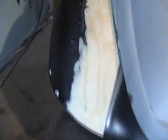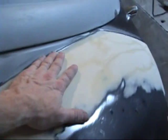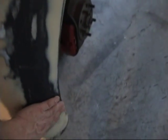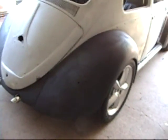The fenders are basically finished as far as the sheet metal goes — crazy man, with the bondo layer upon layer trying to get this nice and smooth. There are a couple of little lumpy spots still, but it's pretty dang close. I have a skim coat filler I can probably use to get the real small bumps out. I had a few little dings and dents in the fender, so I went ahead and filled those, fixed everything down here around the bottom. Basically I'm ready to put the guide coat on this fender and lower it back down to see what it looks like.